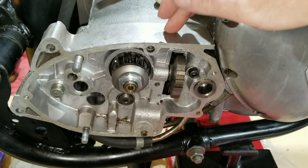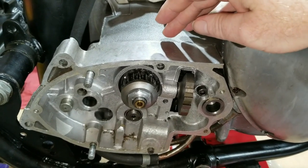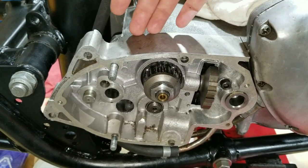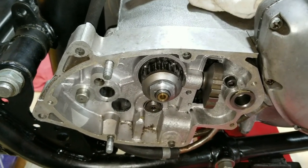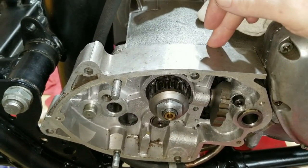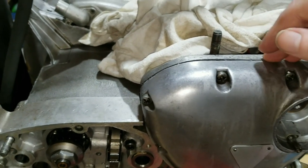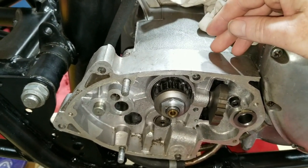We're getting ready to take this cover off and put some 518 Loctite sealant in here. Like I said, there's no gasket here — from everything I found in research, parts books, and manuals there was no gasket mentioned, even in parts books from the early '60s and '50s. We also found that originally there were no gaskets in the timing cover area either, but we put one in — it's not a big deal.